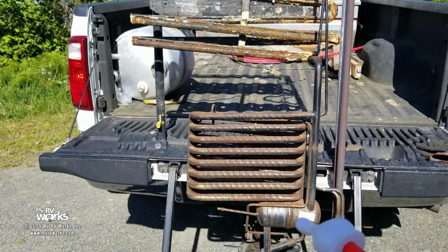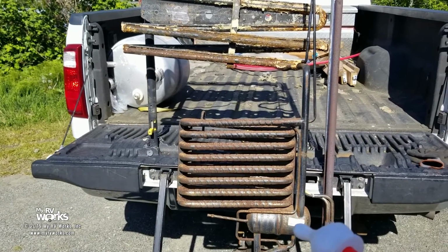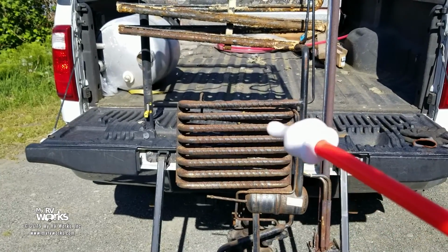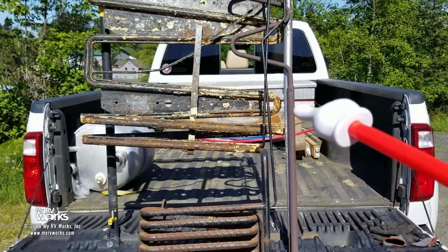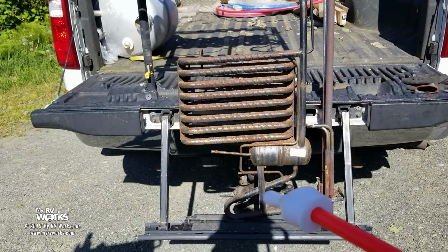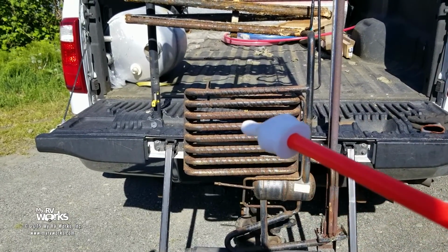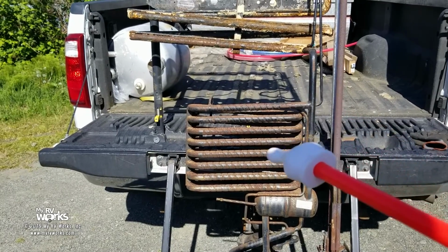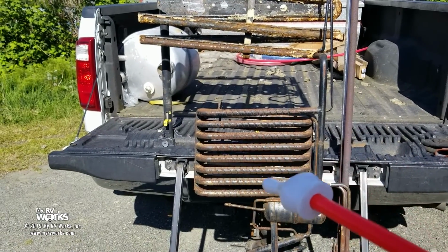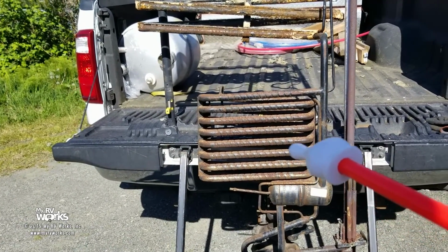Didn't I say earlier that ammonia is absorbed readily into water? Well, that's what's going on right here. We need to get that ammonia out of the hydrogen and free up that hydrogen. As that ammonia and hydrogen work their way back up this as a vapor, the water, remember the water? We left the water off because the water came out of this rectifier and went back on the outer tube here and came down, split off into the smaller tube right here and worked its way back up and joined at the very top. So as that vapor is working up, that water is working down. The hydrogen and ammonia vapor is going up, the water's going down, and all that ammonia is readily absorbed into that water, as we talked about earlier. That's why I went into so much detail earlier on the chemical properties of some of these things.